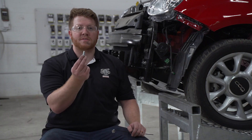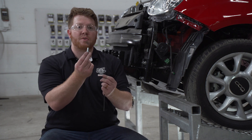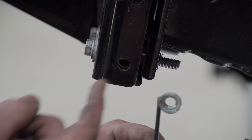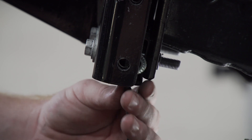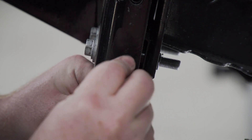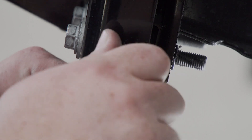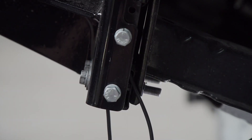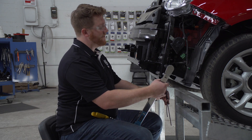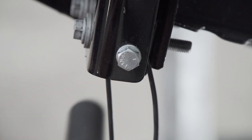We'll repeat on the passenger side. Now for our drilled holes we're going to put a bolt and lock washer in there, and on the other side we're going to take a flange nut with a wire welded onto it, line it up, and bring it behind our bracket. We're going to line it up with our hole, then bring our bolt through, and while holding the flange nut in place, screw it in. We'll repeat on our top hole. With our side bolts in place, we're going to torque them to the manufacturer's specification using a 14 millimeter socket, and repeat on the passenger side.